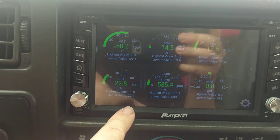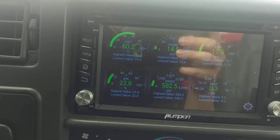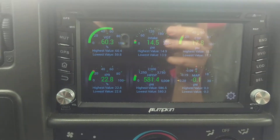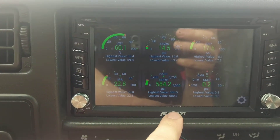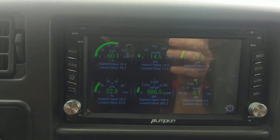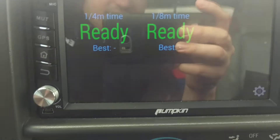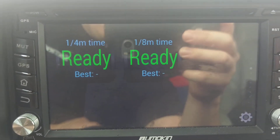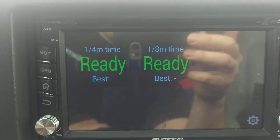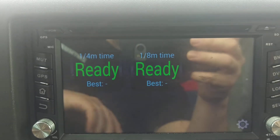It's good to just keep an eye on all these things. The truck is really smoothing out now that I have some miles on it, because before my high pressure oil pump was hanging out around 700 PSI which is a little high for idle — it's coming down a lot. For those of you guys that have a quarter mile to go from a dead stop if you want your times, you can kind of figure that out too.